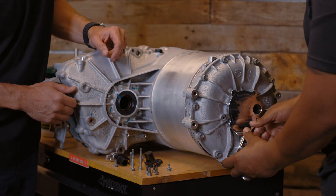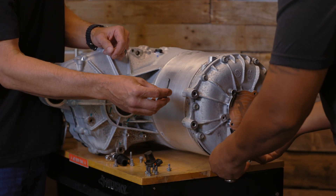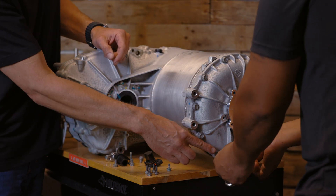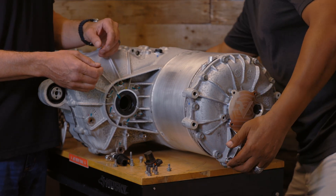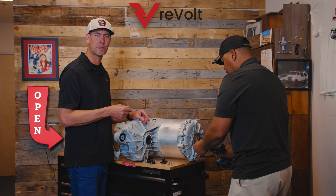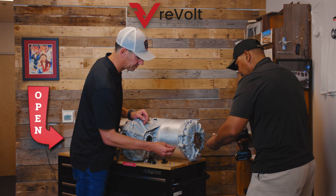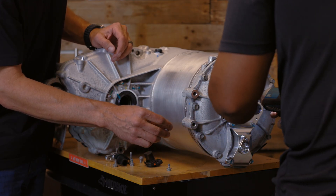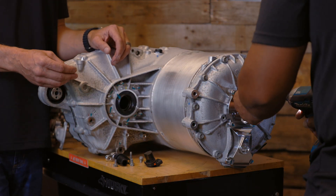It's as simple as putting this back together. There are six bolts holding this into the motor. Make sure the O-ring at the very bottom is clean when you assemble it back together. There's a kidney-shaped O-ring in there — inspect it and make sure it's fine. Put a little bit of lube on it; any ACF grease or similar would work. These are the four main bolts that hold the plate together, and all the torque specs come with our installation sheet.